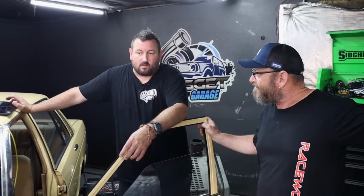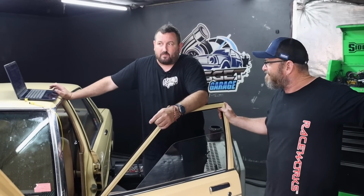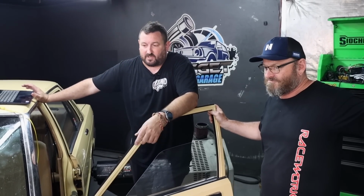You reckon that housing change is choking it enough to drop a couple of hundred horsepower out of it? Which one? Would your stuff make 1,000? It made 930. I had the converter locked. Oh yeah. So it's about 880 without it locked. That's as hard as it'll go though. Actually, no, I lied. It ran out of injector. It's only got 1650s in it. But I reckon it's close to tapped at that.